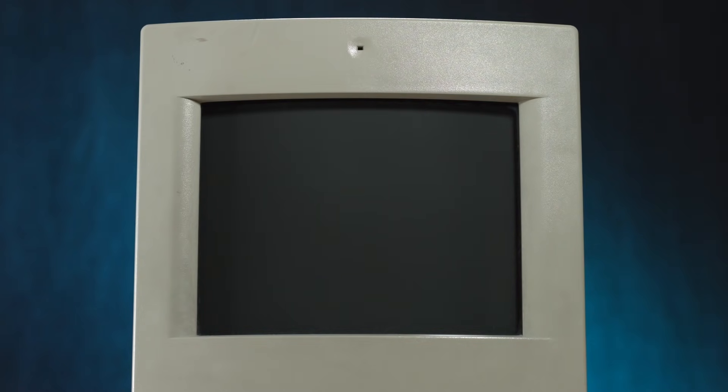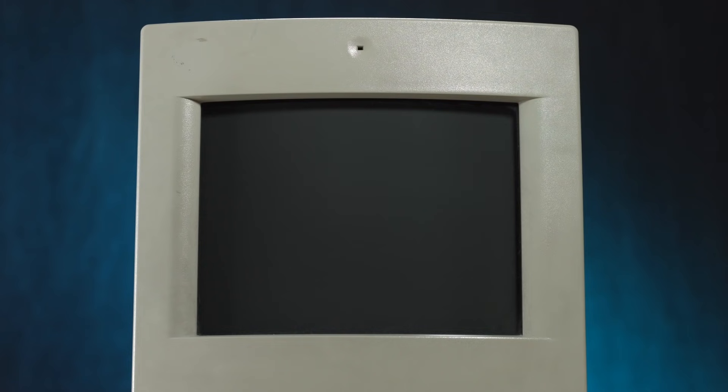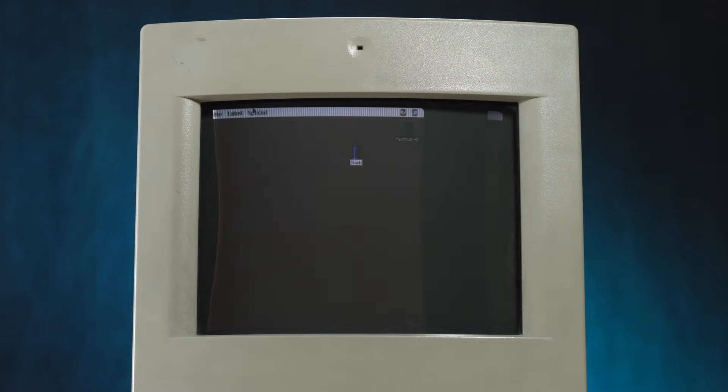A little bit of a stalemate. I'm gonna hit the Google machine up, see if anyone else has had this problem. Colin Wirth, who I collaborated with on Vintage Apple Vault — I think he has a Mystic board. I could also contact the seller that sold me the Macintosh TV and Mystic board and see if he has had a similar issue. I heard there was a way to crank the system resolution to 640x480 with these upgrades, and I wonder if that's what's happening, because everything looks a little bit smaller too. I think something with the logic board is forcing the resolution too high.